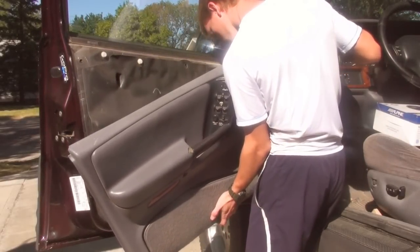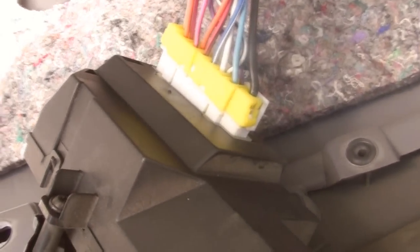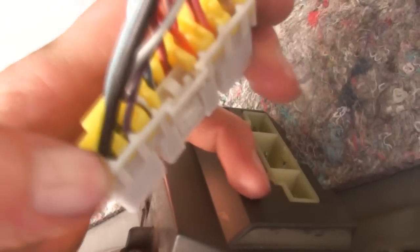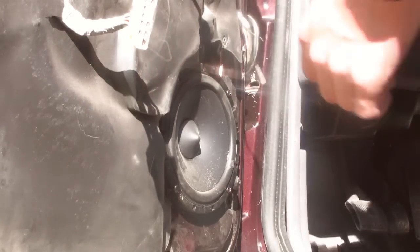You'll have some wires connected to the panel. Take off the top connector first because it gives you a little more room to get to the yellow one. With that yellow connector, if you look on the backside you can see the yellow clip — right in the middle you have to stick a screwdriver in and twist to force it out while pulling up at the same time. The other wires you see are for the tweeter, so don't worry about them.